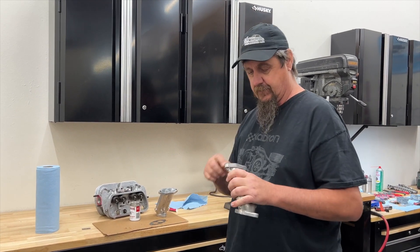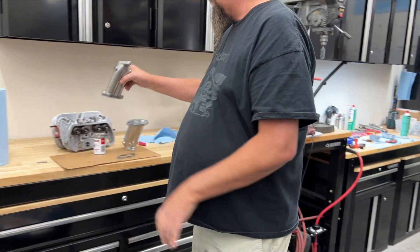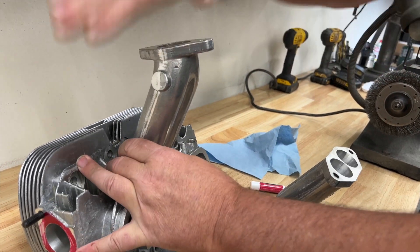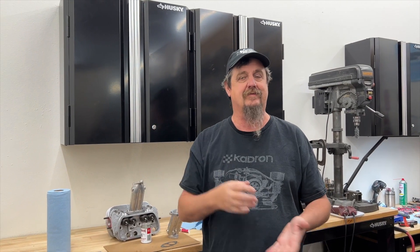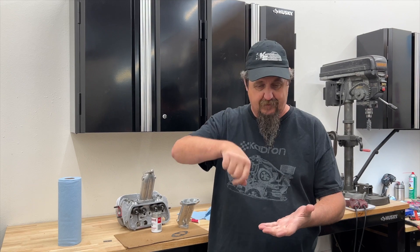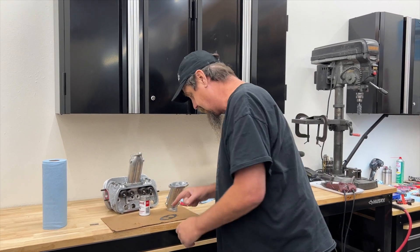The reason we do this is when you put this on the cylinder head, it's glued on this side and there's chapstick on the other side. When you put it on the cylinder head — it's really tight anyway — and when you peel it back off after several cycles of the engine, it's going to come right off the head and stick to the manifold. There's nothing worse than goobering up your intake gaskets with silicone and having to get in there with a screwdriver and a brush to get it out. I've taken these on and off the blue car like six or eight times — you don't even have to change the gasket, just torque it back on.